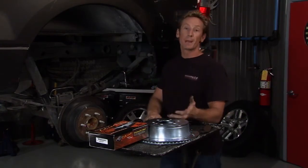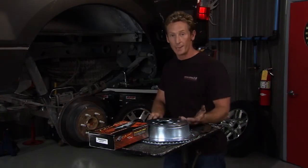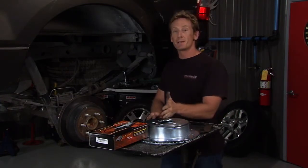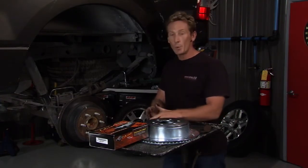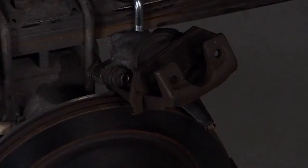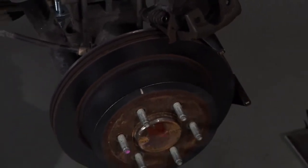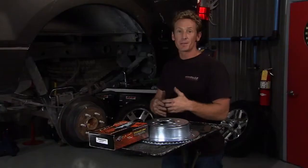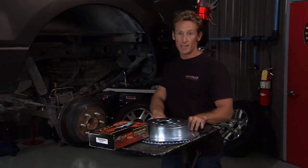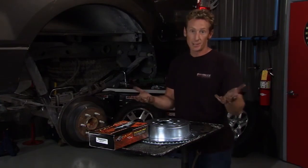Just because you're going to put in some new brake pads and a new rotor doesn't mean you're ready to rock and roll — you've got to break in the pads the correct way. The idea is to do some moderate stopping from about 45 to 5 miles an hour. What you're trying to do is get an even wear of brake pad material onto the rotors without developing any high spots. The way you get a high spot is if you hit the brake suddenly or come to a complete stop right away. So once you go ahead and do six or seven of those cycles, you've got enough brake temperature into the pads that they'll have the even transfer, then you're ready to rock and roll. All you have to do is drive around a bit, let them cool down, and your brake pad installation is done.